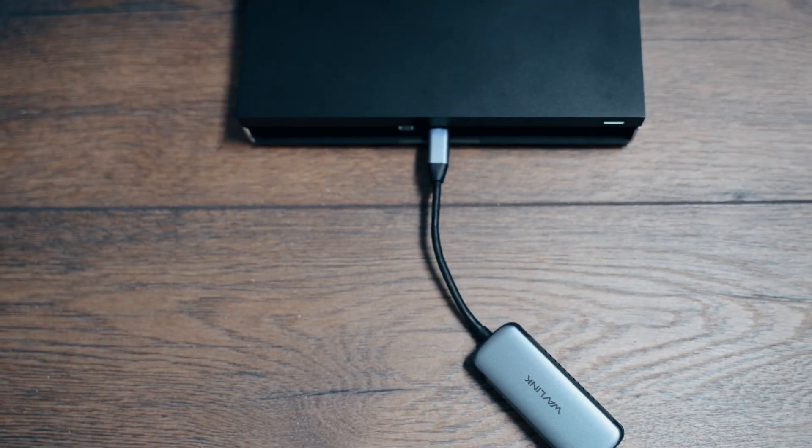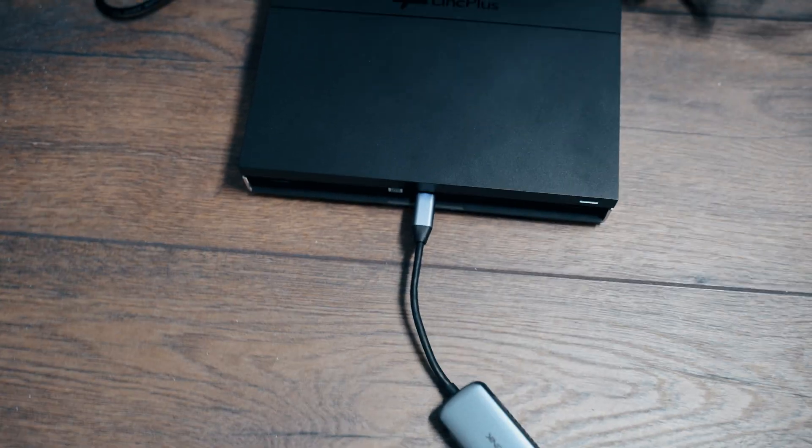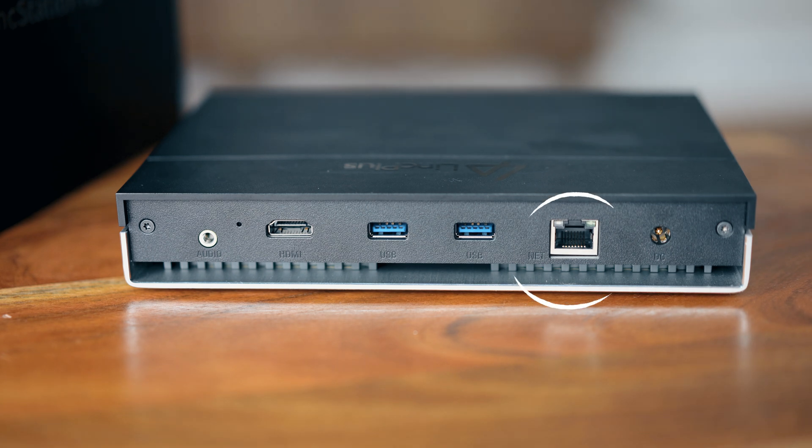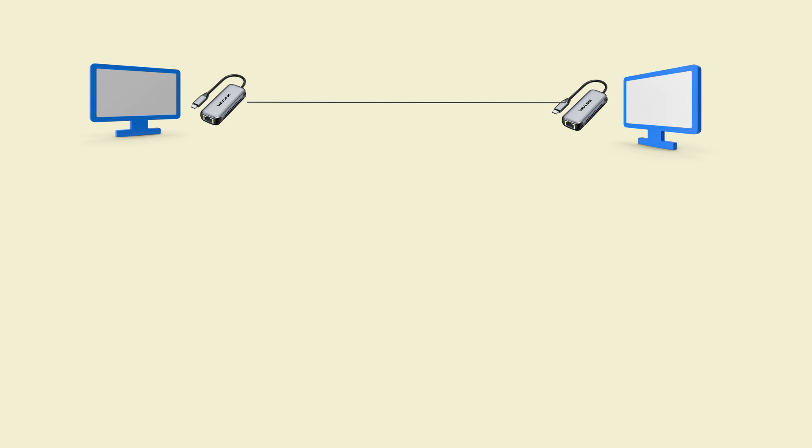For my next test, it was a direct peer-to-peer connection between my main computer and my Unraid NAS running on the all-SSD LinkStation. As I've pointed out before, the LinkStation only comes with a 2.5 gigabit card, so this seemed like a great candidate. Since this device supports Auto-MDIX, I just used a standard CAT7 cable — no crossover cable needed. Luckily, Unraid has an awesome plugin catalog.